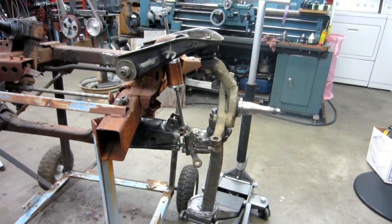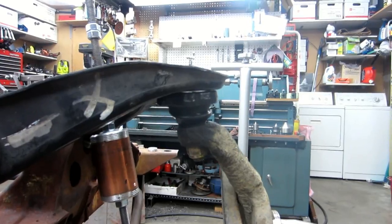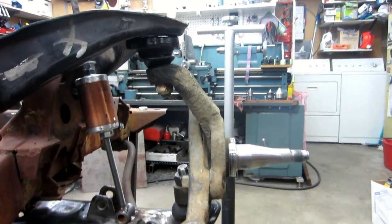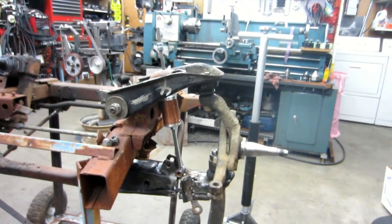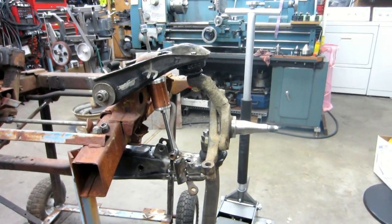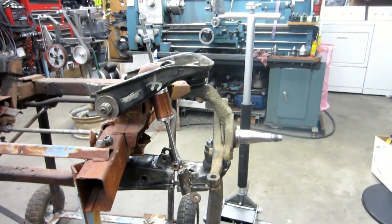The reason for checking this with the arm is that if this will work, then I don't have to build a custom arm for the guys who want to go really low. The ball joint is right about in the middle. I don't know if this is necessarily ride height yet — I've still got to do some checking — but it certainly puts the ball joint at a better angle.